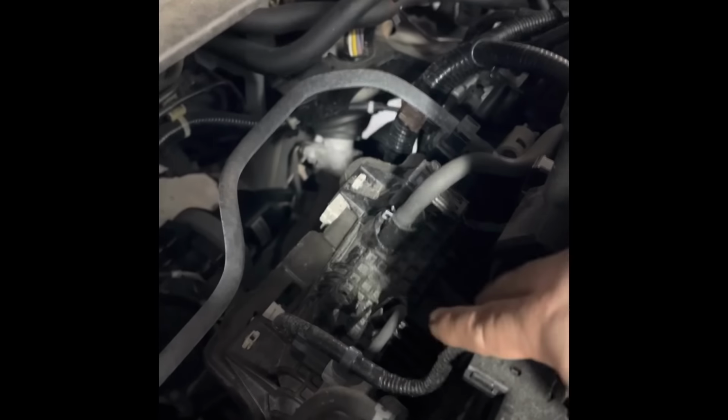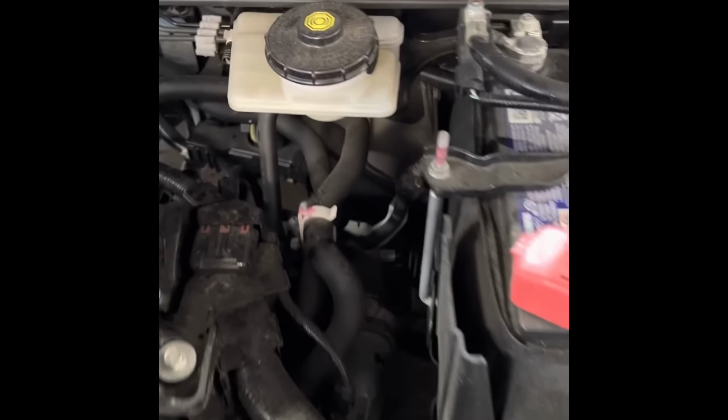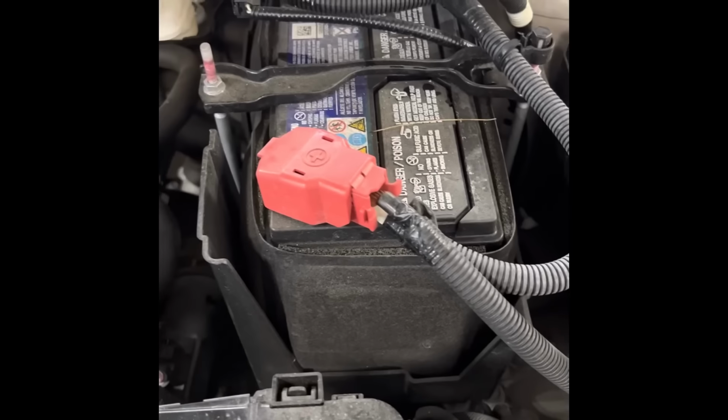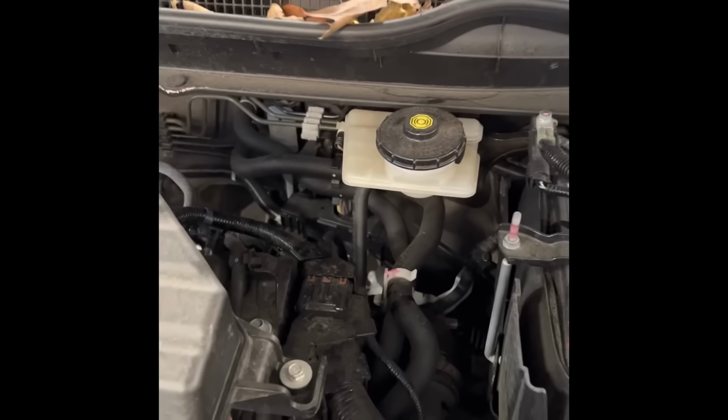The injector on this car actually sits underneath this intake manifold, so this manifold has to come out. This box that comes out is pretty easy. It's only two holes right here and a couple of 10mm bolts. I recommend taking out the battery, which makes it easier. Then take out the hose right here going into the throttle body. It's only two 8mm clamps, and then we go from there. All right, follow me.